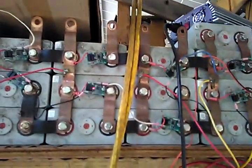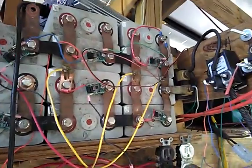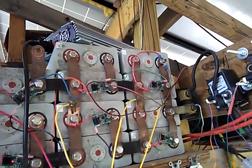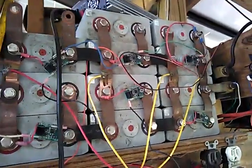You can put as many as you want — 12, four, or just one. But we have to have this control board, which takes about an hour or so to set up, and you also need a big relay. Our other situation with this is that when things get overcharged or undercharged, it cuts the system off and won't start back until the over or under voltage is corrected. So our problem is if you drained it all the way down, the charger wouldn't come on because the batteries are too low. Of course, if you take the load off, they'll float back up a little bit and then the charger can catch them.